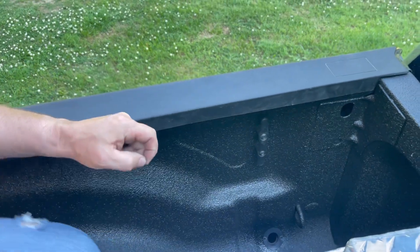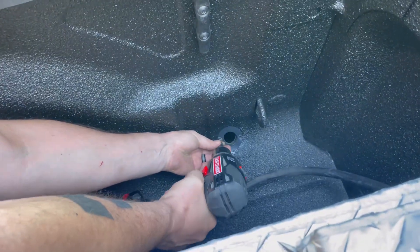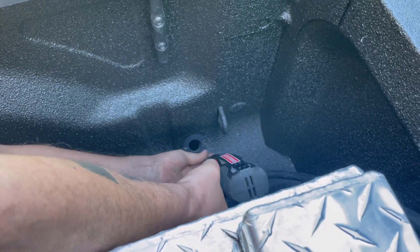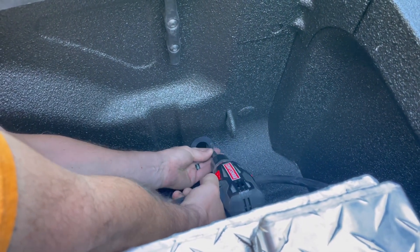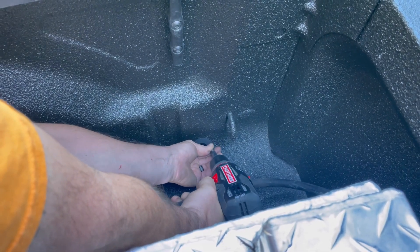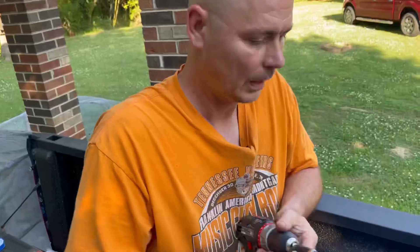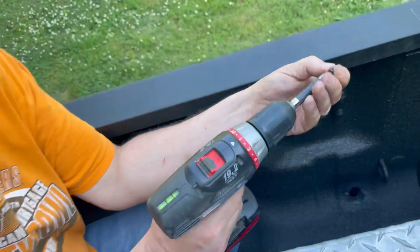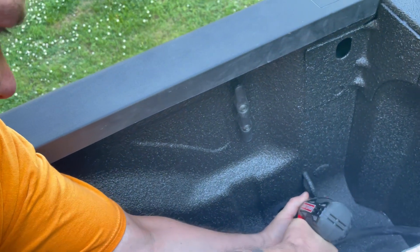We drilled a perfect size. We don't want any of our hoses getting on that metal and breaking, causing fuel leaks. I went and got a drill bit and poked a pilot hole in it first, then went ahead and drilled a small hole so you may have to do that too. Got my Phillips screw back in it. The hoses will go right down in there — that's the vent hose — and I'm going to have to fix this one. I'll drill a small hole right there and get this one.